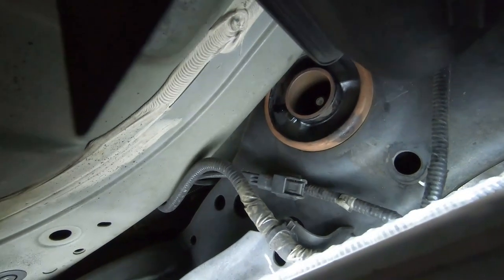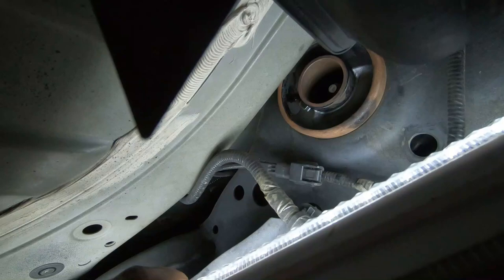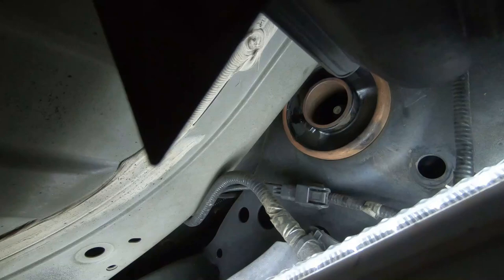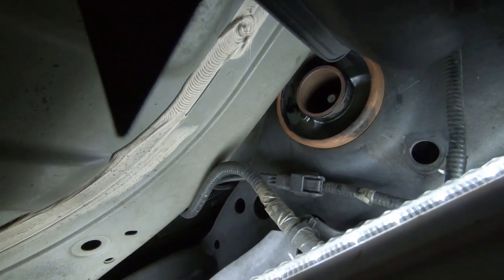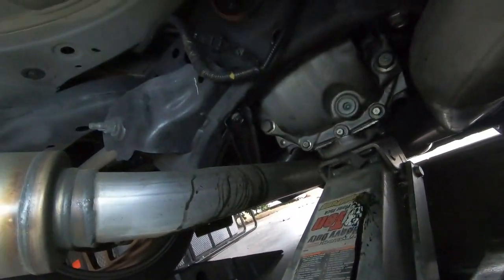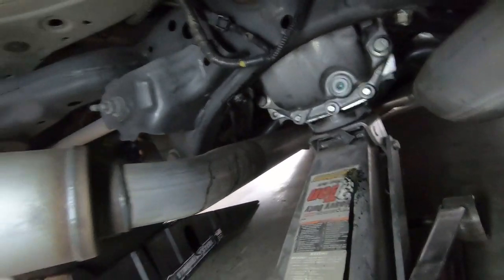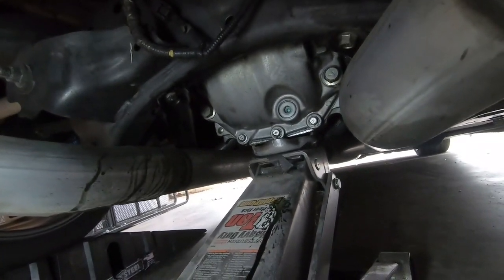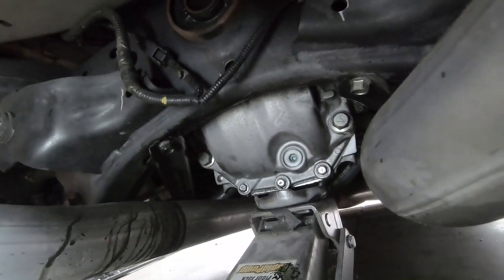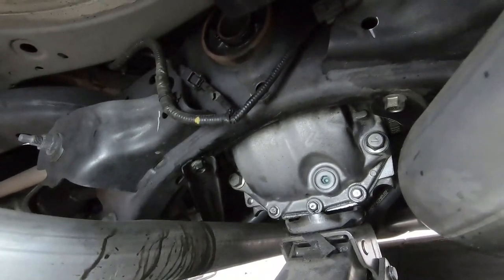I can actually see now where the rubber on top and bottom is sort of bulged out again, so there is some pressure of material in there — in this case it's five-minute epoxy. It shouldn't leak out; it's thick enough and it's going to harden pretty quickly. I put the floor jack underneath the diff and just put a little bit of pressure on it to get the diff bolt centered in the bushing. I got some of the epoxy on the bottom side of the bushing as well. That's really it for the sketchy rear diff bushing fix.